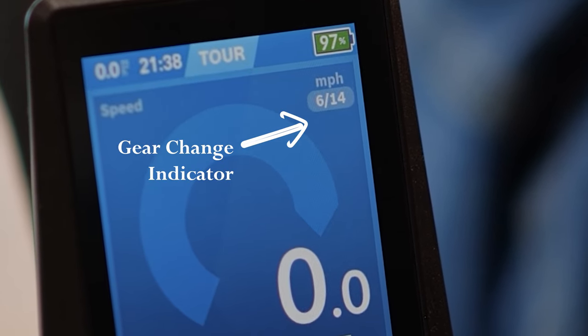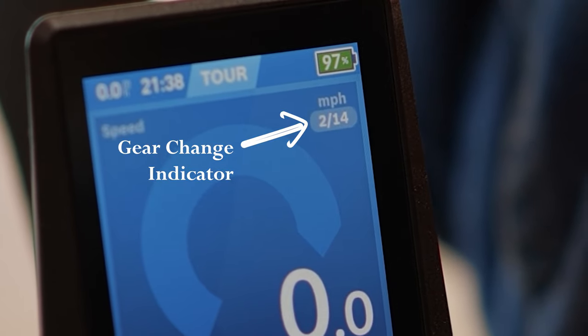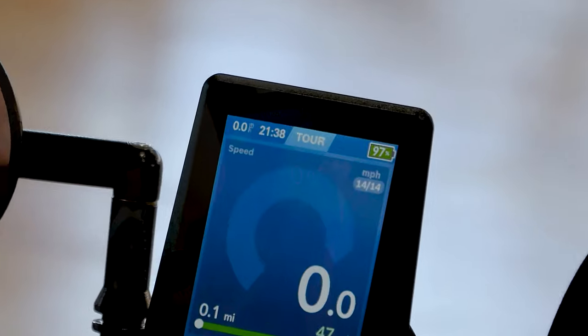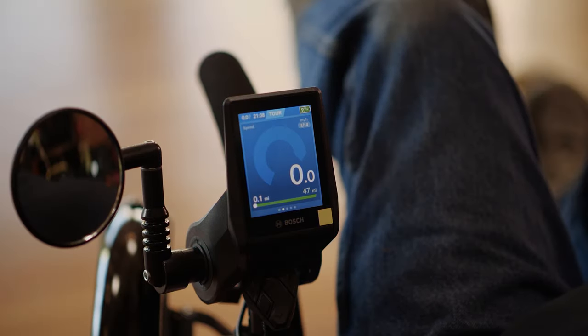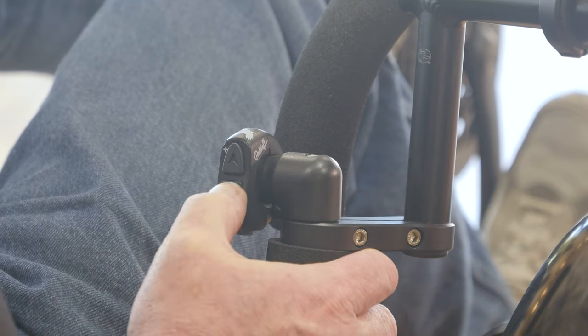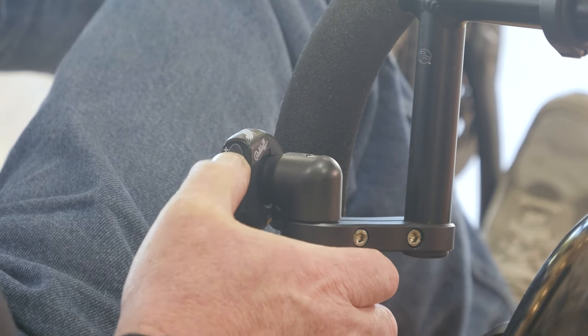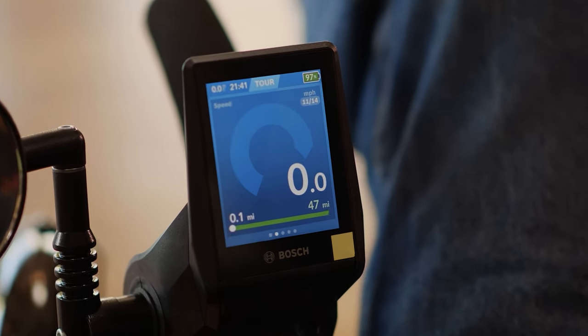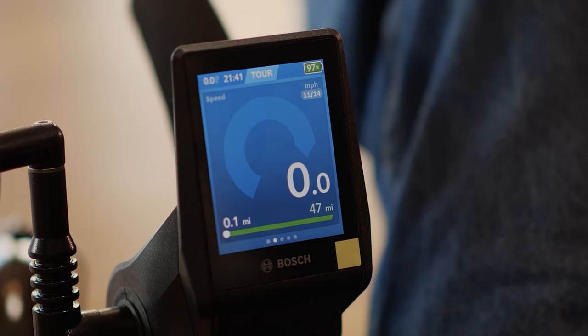The noise you'll hear when it's shifting gears is right like this. If you just hold down the button, it'll run three at a time until it gets up to 14. Right now it's in 14th — if I just hold down the button, I'm already back to first gear. You can shift it one at a time, or if you hold it down it'll jump multiple gears at once. That's great if you crest the top of a hill, start going down, and want to go fast — just hold it down and jump all the way up to top gear. The gear shifting is done by the switch mounted on the right-hand side, very easy to reach as you're riding along. Just hit it with your thumb on the bottom to downshift, or the upper button to upshift — nicely marked with a plus and a minus. When shifting gears, the Roloff communicates with the Bosch system to back off the motor just a bit, so there's no strain on the gear as it's switching from one gear to the next.